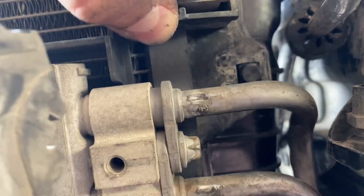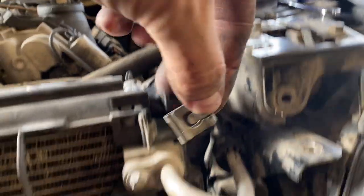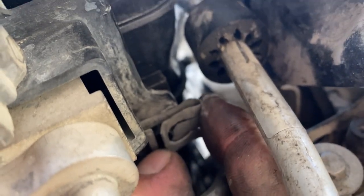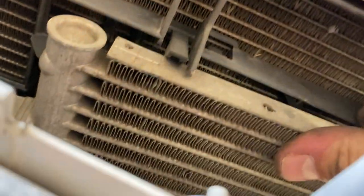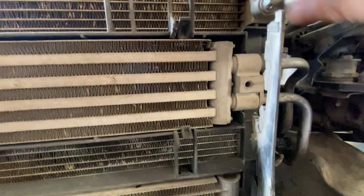To connect the front support there are some clips here where the front support clips in, and then we have an alignment hole up here which a shim slides over and locks in place — it has an opening on one side, so you just place it next to it and push it on. Locked — pretty smart system. Both sides done now. We reposition all the coolers that we loosened and just make sure they're refastened in the front support bracket using the plastic clips that hold it in. These are literally just held in by some tabs that get pushed back or down and then it slides out — re-clip that in.